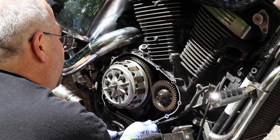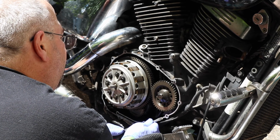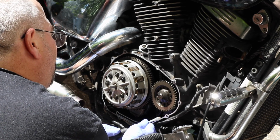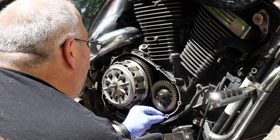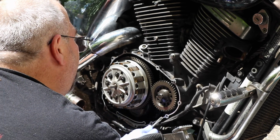A little bit of gasket stuck on here. That's coming off. A little bit gets into the engine. Take the tip of your finger, wipe it out. It's not going deep in there. Don't make a lot of metal filings. That would not be a good idea.